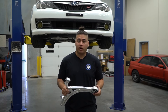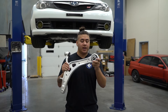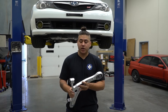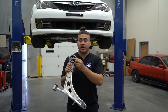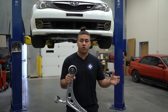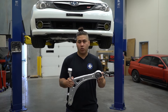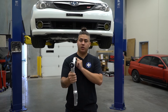A few of you might ask: why do I need an aftermarket control arm? First off, it is an aluminum construction, so you're going to be shedding weight. It's also got these pre-pressed in hardened polyurethane bushings, so you're getting rid of any old worn out bushings that are soft and give you slop in your steering. These ones are going to be stiff and give you great steering feedback. One more thing is that it has added caster. When you add caster to your car, you're going to be improving your high speed stability as well as your cornering effectiveness, which is huge. Whether you track the car or daily drive it, you're going to notice a really big improvement in how it handles because of this added caster and these hardened polyurethane bushings.